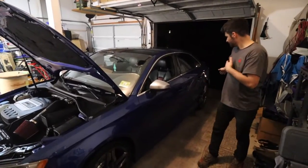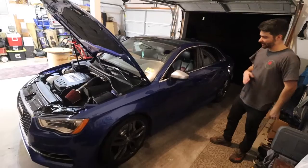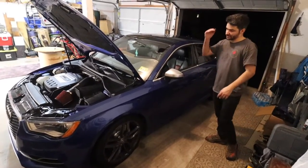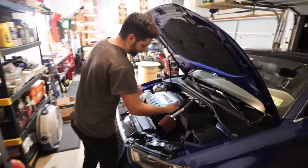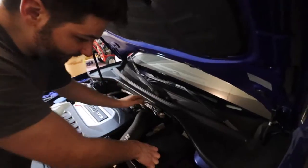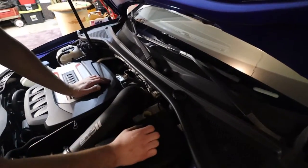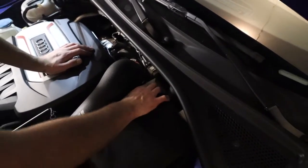So we just finished the driver's side and everything bolted up perfectly. No hiccups, nothing broke. So that was pretty much, like I said earlier, same as that side. So now what you wanna do is, since you pushed the calipers' pistons in, you could have some brake fluid coming out of the reservoir, so clean it up there. I didn't have any, I already checked the level. So check the level, put the cap back on.